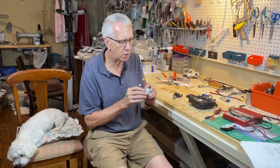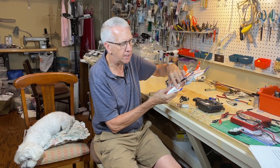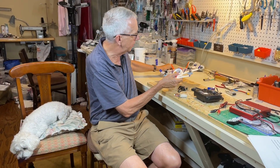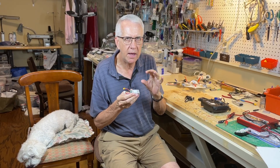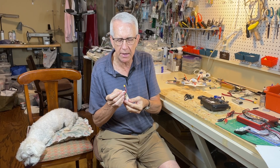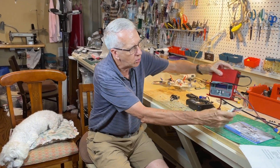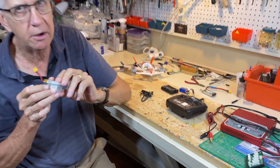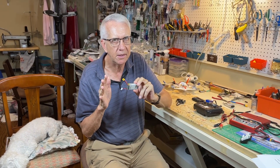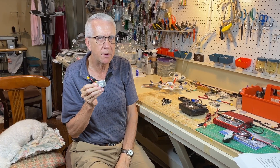I need to talk about the battery. This is the 2-cell 1,000 milliamp lithium polymer LiPo battery that came with the airplane. When you take it out of the box, the battery is already installed. It's an XT30 connection. My experience with lithium polymer batteries is that once you have a 2-cell battery, it's important to have a quality charger. You can tell by the balancing plug — that's how you access the details of the two cells. Where I found this battery had a problem was my normal charger immediately said it couldn't charge because something was wrong with one of the cells. The minute you find something wrong with a cell, don't try to fix it — you could start a fire.